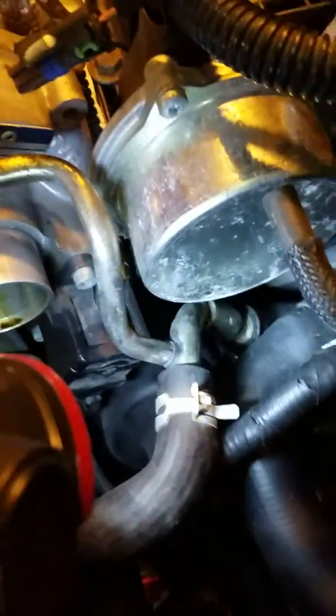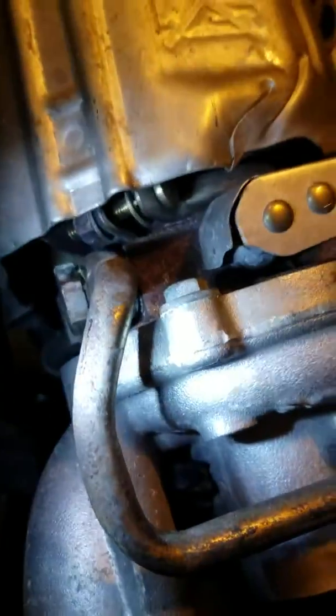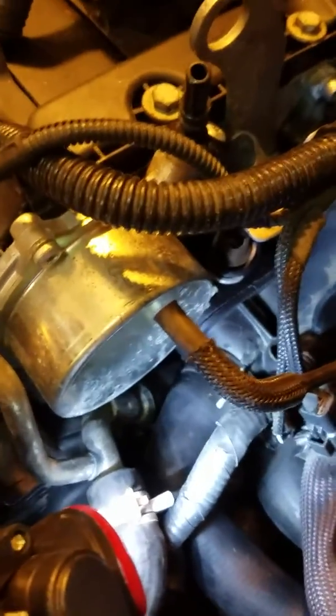All right, there's one more. There's 5 hoses. I almost forgot. The other hose is this one. It comes out the bottom of the reservoir we already disconnected. Runs up this way. Splits off with the pipe that runs to the turbo right here, okay, for coolant, and splits here and runs, see if you can see that, we got back down here, it's hidden, and it goes down to the bottom of the thermostat housing body. So I'm going to say that's going to be the last one after I unbolt it to take off, and obviously the first thing to get connected before you bolt it up seems to be the logical progression.